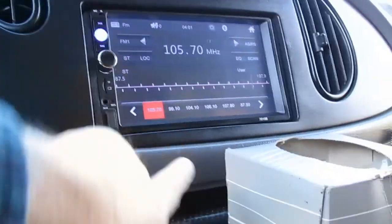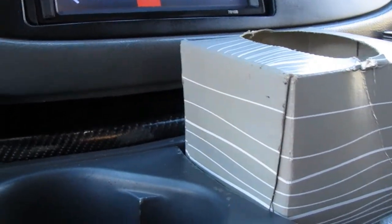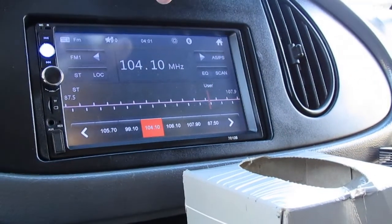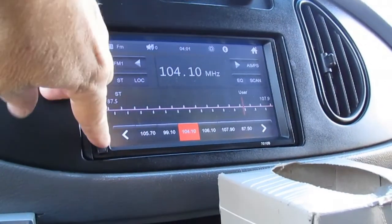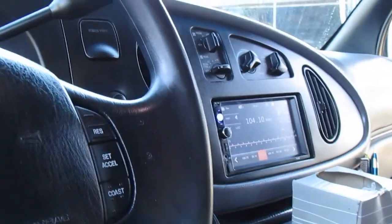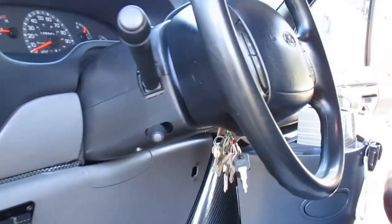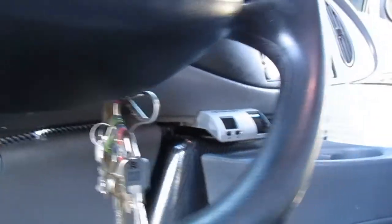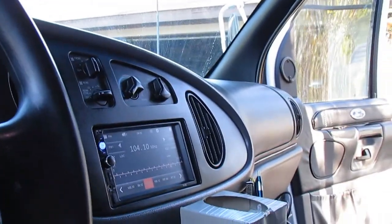You can see the backup camera on the touchscreen — touch it and it cycles through stations. There's also a scan function and multiple modes. Air conditioning is ice cold, heat is perfect. In fact I put in a new heat exchanger because that was a problem when I got it — not an easy job. At the same time I cleaned out the air conditioner, cleaned out the condenser so it smelled better and improved airflow.